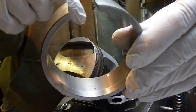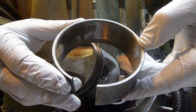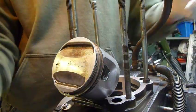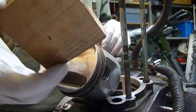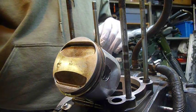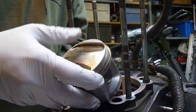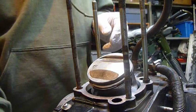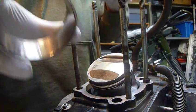There's a slot in there for the conrod. It's thick at the top, tapered inside, thin and smooth in the middle and at the bottom. Lightly oiled it. My super tools are also a bit of old timber and a hacksaw blade. Just wind the piston down to the bottom, lightly oiled inside, conrod gap at the back.